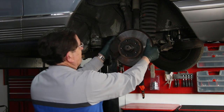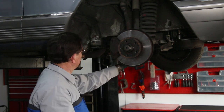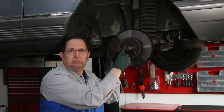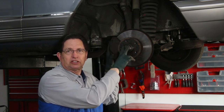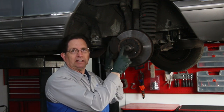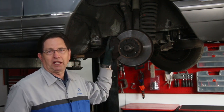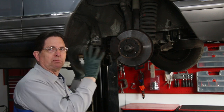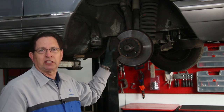There's some other things going on. I grabbed a hold of this and look at the play in the steering. I've got some issues with steering rods and front suspension. I'm going to check bearing play — that feels pretty tight. But wheel bearings are an issue too on these cars because they get neglected. I'll pull the caps off and check how the grease looks underneath. When you're doing the brake inspection and restoration, you want to inspect these wheel bearings too. We have kits with special tools to help you get the wheel bearings and races replaced in your own hubs. In the next video in this series, we're going to do a complete suspension inspection — walk completely around this car underneath and look for any signs of components that need to be fixed or replaced.